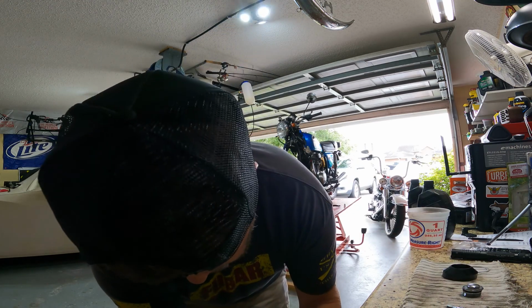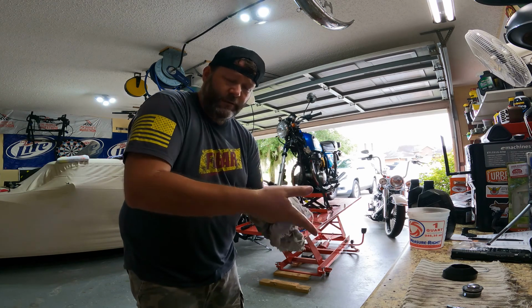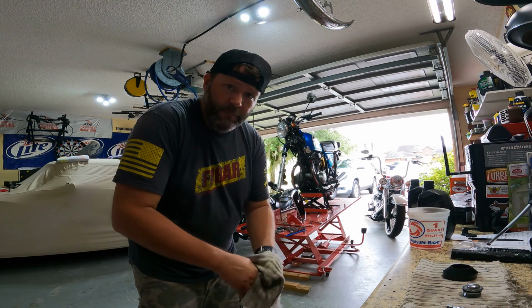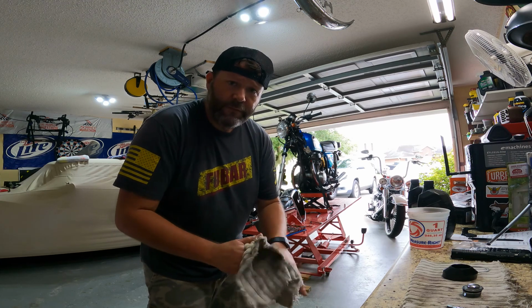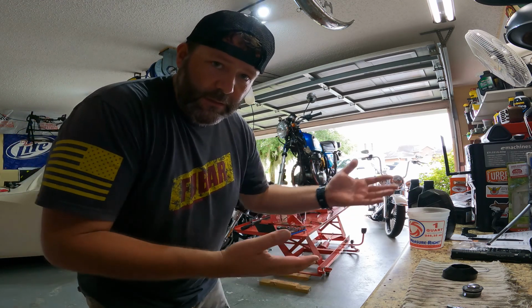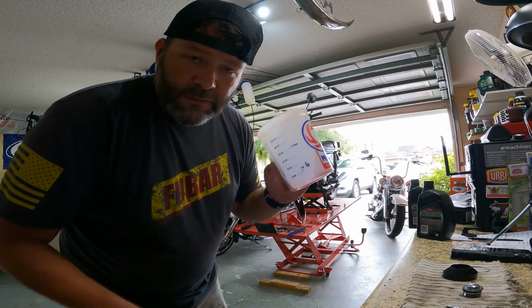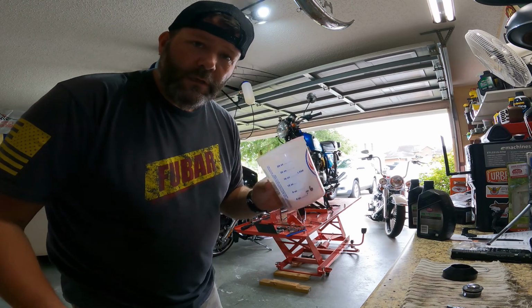So I'm gonna go ahead and set that thing down there. I'm gonna use my nasty rag to wipe my hands, why not? And I'm gonna measure up the fluid and dump it in there. I believe it's 4.7, you know, 4.5, 4.85, whatever. You get the drift. 4.7. Measure it out however you feel like you need to. I use this. It's not super precise, but again, it's a motorcycle fork. So I'm gonna go ahead and do that.